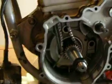There is too much slack in the chain and the sprockets — you can't get it to jam up that way. There's just too much leverage to the transmission. When you're done taking the basic parts off, you start getting to the cam chain itself. A few things that aren't intuitively obvious. I've actually pulled mine out already — this is my new one.